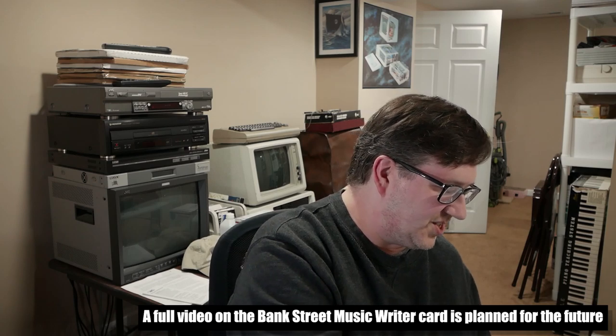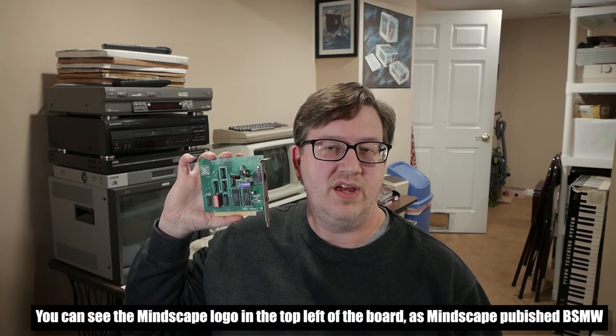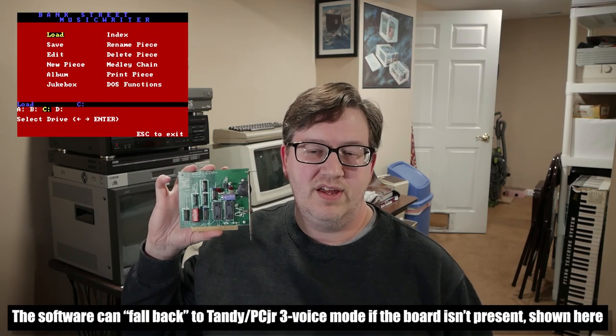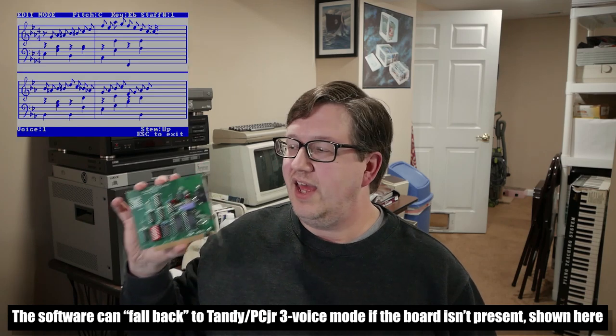Probably my favorite piece of hardware — and the rarest thing I own, with only one known in the world — is the aforementioned PC Mockingboard, a.k.a. the Bank Street Music Writer Card. It is two AY-3-8913 chips, the same as the Mockingboard. So it's capable of six voices in mono — not stereo. Out of those six voices, they can be square wave tones with a 16-level volume, or the noise generator with an envelope mode and white noise. Effectively, listen to any Apple II Mockingboard audio and you'll hear what this board can do. In fact, Bank Street Music Writer was ported to the Apple II and supports the Mockingboard on that platform, so you could hear the exact same thing — but this is an ISA card and it's mine.